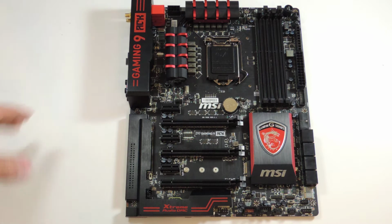Basically, it allows for both of the controllers to work together. So wireless AC can never really be as fast as the wired NIC. That's true. A 2x2 wireless AC maximum is 866 megabits per second, if the link negotiated is 866 megabits per second. The issue with wireless AC is that distance plays a large part in performance. And the truth of the matter is that wireless AC can't reach as far as wireless N can, especially not in a house with thick walls. But it still has a little merit.